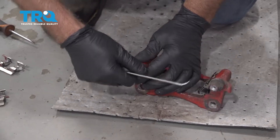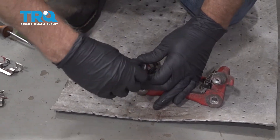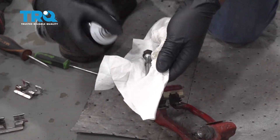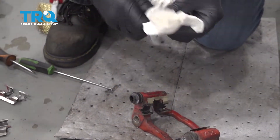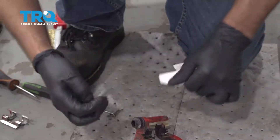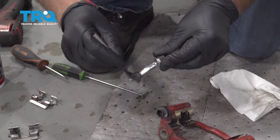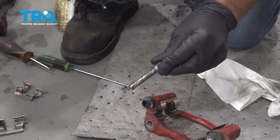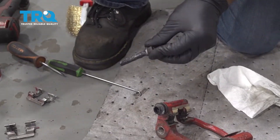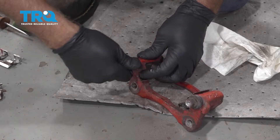Take the slide pins out — if you have to, you can use a pick to slide them out. Take a little brake parts cleaner and clean them up. If the pin is extremely corroded, you want to clean in the bore as well, but if it's not too bad, just take some brake caliper grease, grease up the pin, and slide it back in. Make sure it seals on the boot all the way around. Do the same on the other one.